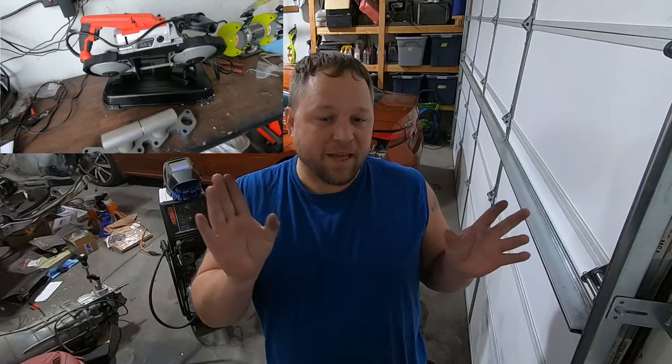Hello and here we are with a new video. I'm recording this after I've done everything because my intro footage is shaking like an earthquake. So I'm going to throw a photo of some gadgets and things I bought — a bandsaw and some log manifold pieces. What I'm trying to do in this build is make some log manifolds to go up to the front of the engine, because my goal is to single turbo this engine. I'm not going to build the rest of the manifold in pieces until I have it sitting in the car to figure out things like the radiator, cooling, and where the belt is going to interfere.